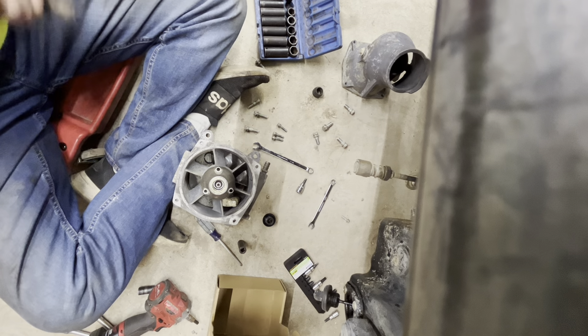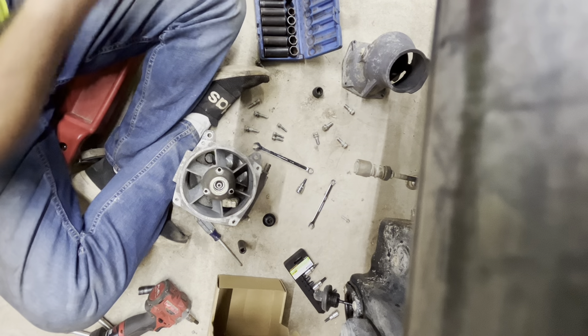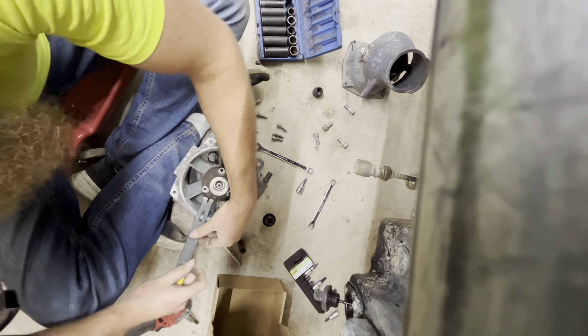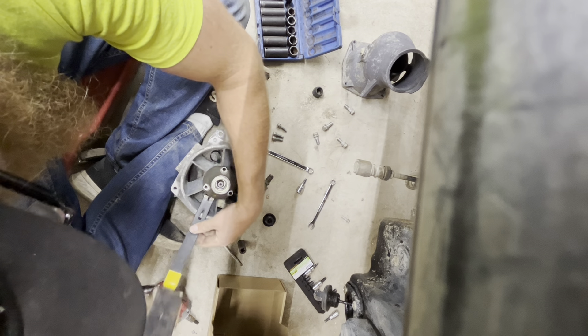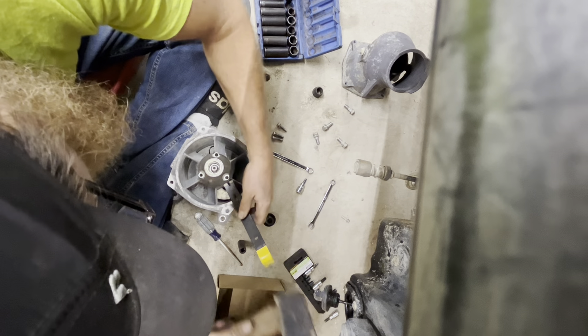To split the case it's four 12mm bolts, and then it just comes apart. There's no gasket. Last time it was corroded really bad, so I sanded everything down and it came right apart this time. Here's the rock — pretty good size one. She's lodged in there, so that's going to be fun. Probably going to have to beat it out once I get the impeller back off.